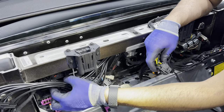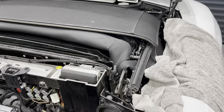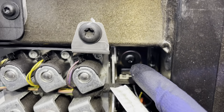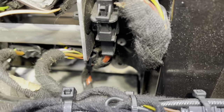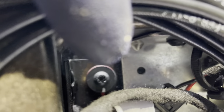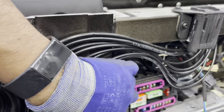Just to show you where the bolts are holding the cartridge in place — there are four bolts. There's one there, one further down at the bottom which you access through this hole here. Coming around the other side, there's one on the top and another one at the bottom. I've also removed three bolts on the fuse box just to get some extra access.